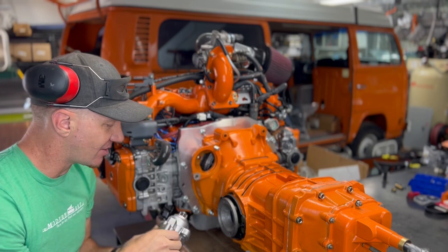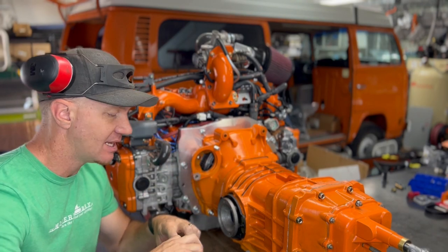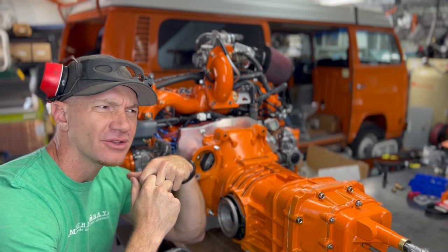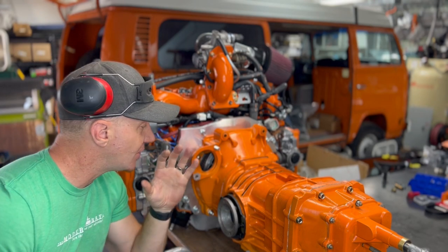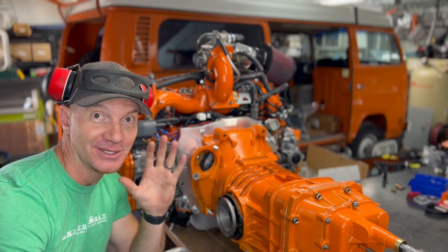And then it has to have the correct depth engagement. It's actually quite complicated to nail this. Where the teeth engage with the flywheel right in here, if I remember right, it's either 35 or 40 thousandths, the depth that you measure where the teeth actually meet each other. So this has taken a long time, I'm just gonna be totally honest.